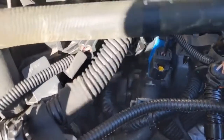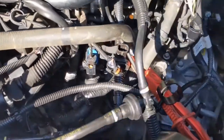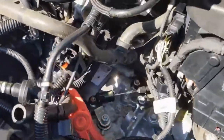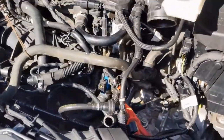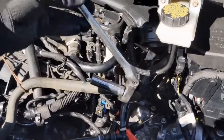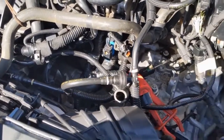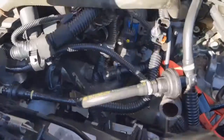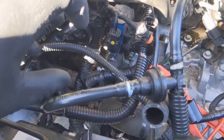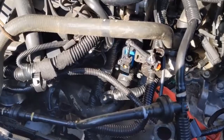It's still not the best access but I'm trying to get to that bolt down there and there's just no room. With some effort I got that top bolt — what got it was a deep socket with an extension like this. Once I got it loose a certain amount I was able to back it off with my finger on the socket. I'd recommend getting this one first — it's the hardest, but if you get the bottom ones first and do this one last, the starter could kink a little and that bolt can be harder to come out.